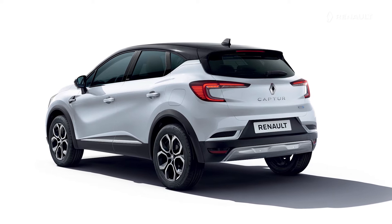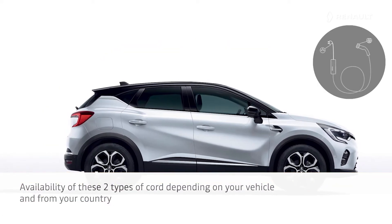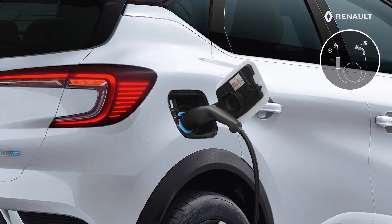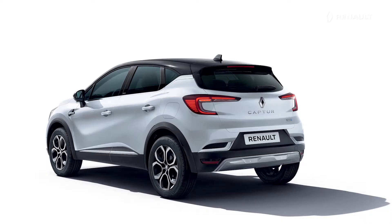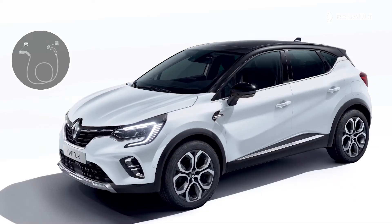The traction battery can be charged using two types of lead: the Type A charging lead and the Type B charging lead. The Type A lead allows charging through a socket dedicated to the vehicle for regular use, or through a domestic socket for occasional use. Sockets must be fitted in accordance with the instructions in the user guide supplied with the Type A lead. The Type B charging lead is for a specific wall unit or public terminal for standard use, and is available from a Renault agent.